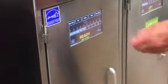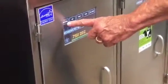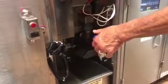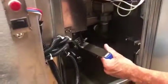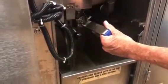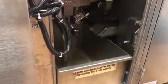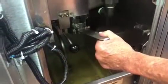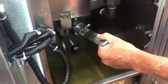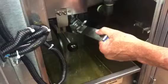To filter the fryer, turn the fryer off first. Open the door and remove the handle. Here's your drain — open it slowly at first until it puddles. Once it puddles, open the drain all the way.